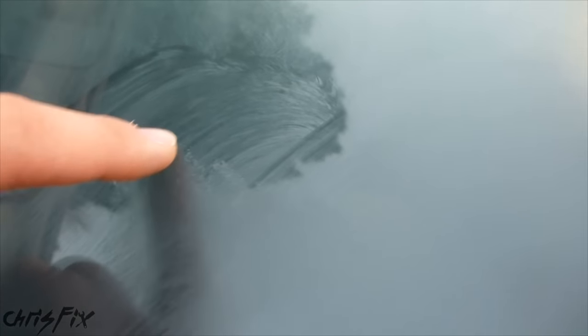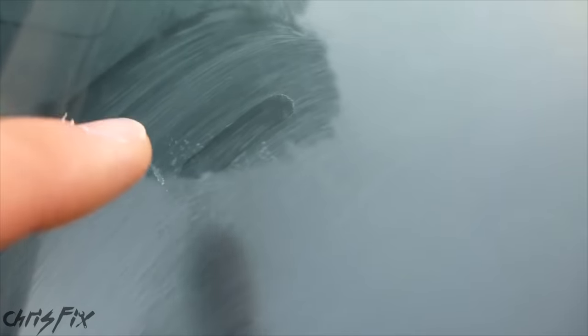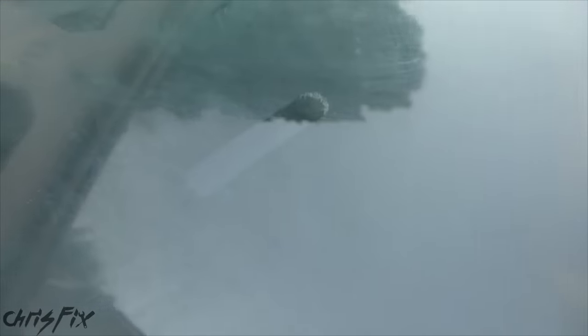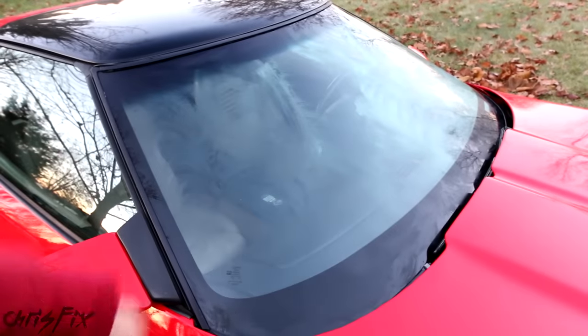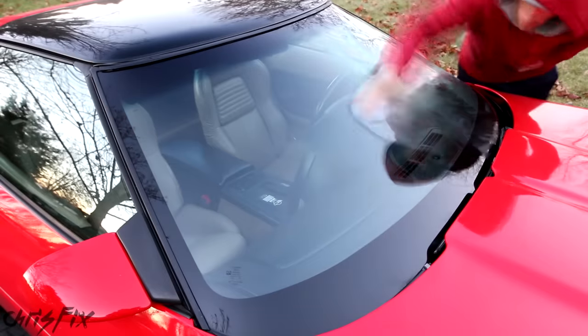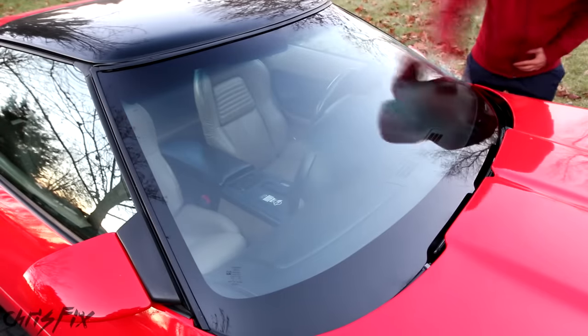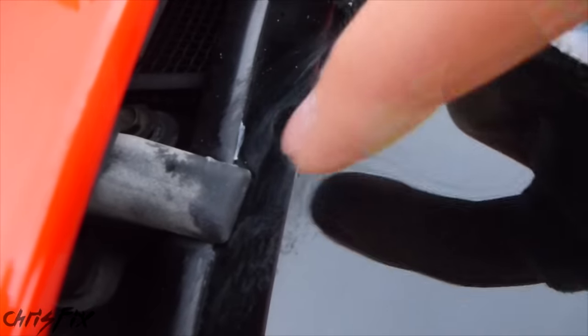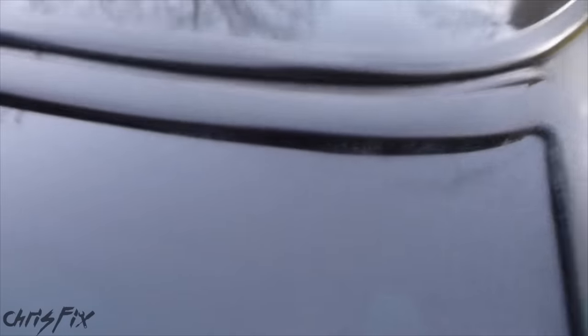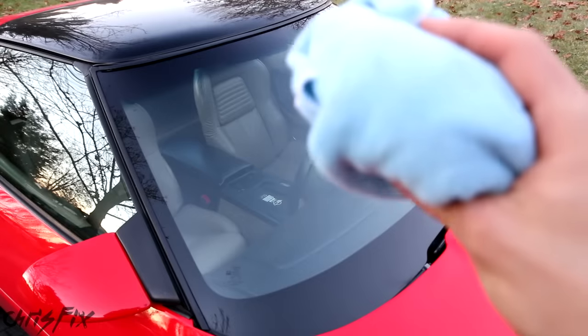To test if the wax is ready to buff, take your finger and run it along the wax. If your finger leaves a smudge and it's not completely clear, the wax isn't ready. You want no smudge and the glass underneath your finger to be completely clear after you rub it. After a few more minutes, if there's no smudge and the wax kind of builds up at one end when you push it, that's exactly what you want — it's ready to buff off. Get a clean microfiber towel and buff off as much wax as you can using circular motions. Make sure you pay attention to details and get the wax off all the black trim pieces, because any wax left on the trim will turn white and be very obvious.